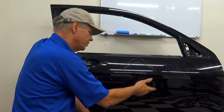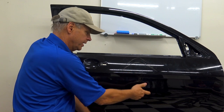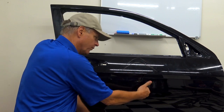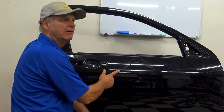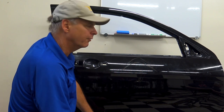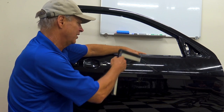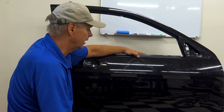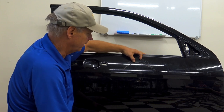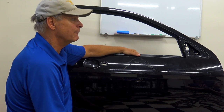So, that's the first thing. Energy got trapped in the body line, or it wasn't hit hard enough to even do anything. But if it got hit relatively hard and went right past the body line and still formed a crown, what do I do then? Usually, if you have a 90 degree crown that went past the body line and still formed a 90 degree crown, that's a fair amount of energy locked up in there. And of course, if it's blasted back here, I'm recrowning that thing.